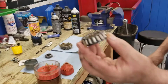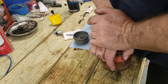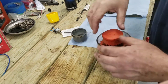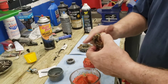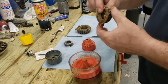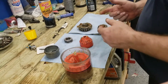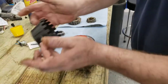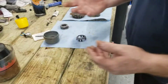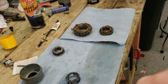Let's pack that little bearing — little bearing into the packer it goes. Squeeze it down. You should have a bearing packer in your toolbox — if you don't, why not? It's a great tool to have. Put the excess grease on the outside of the cage. Now the bearing is ready to go. When you're done with your bearing packer, put the cap on it to keep dirt out of your bearing packer.